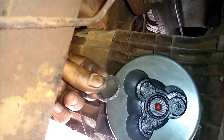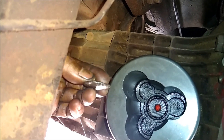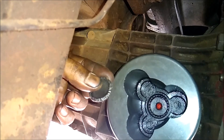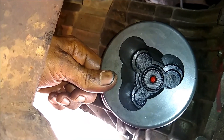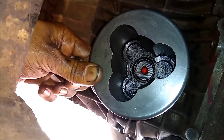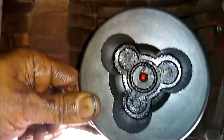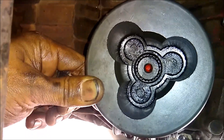The engine force causes it. So that's it — I'm not going to reuse this piece because there's no point putting a dented piece back in; it won't fit properly. This was sitting at the bottom. To fix that clunk, you'd have to replace that shaft plus the tulip — but since nobody will do that, all cars will keep giving that clunk for the rest of their lives. All my cars have this play here — all of them. Don't worry about it, but just for the record: that's why the clunk happens when you release the clutch.